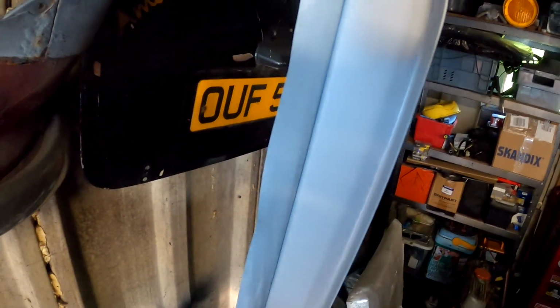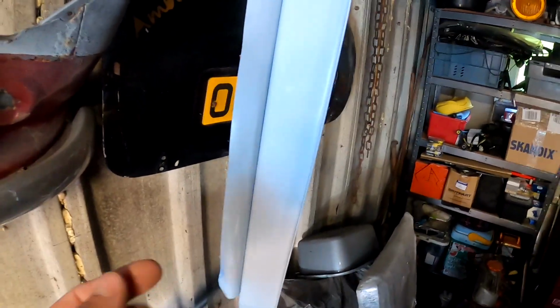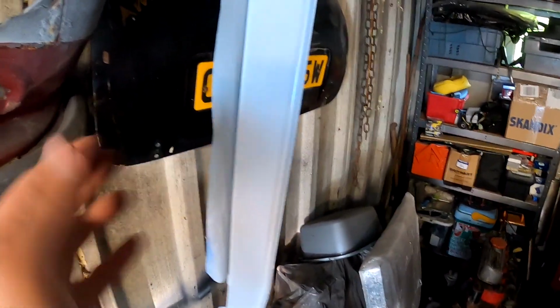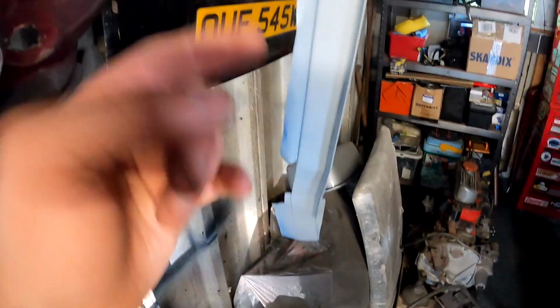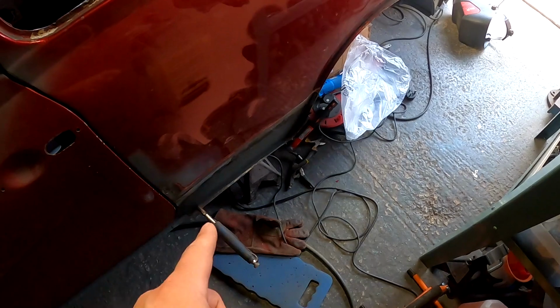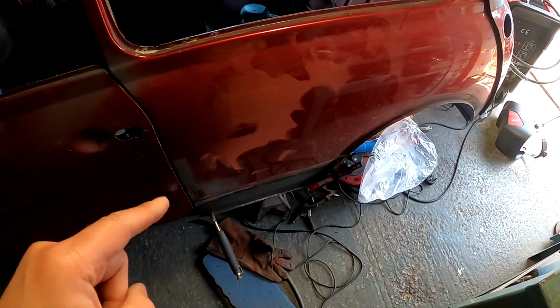And we've got that all nice and protected now, because it came as bare steel from the machine. So I'm not going to put it in there and not be able to get to the underside of it, which I'll never see again very soon. So obviously there's tapes on there, there's some punch holes just so I can do some plug welds inside the bin. But we'll whip this panel back off, we'll get set up, we'll get welding. No more talking from me, we're just going to get stuck into it.